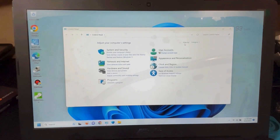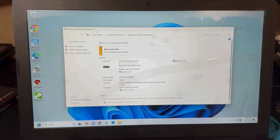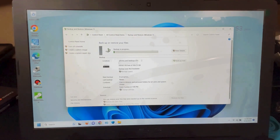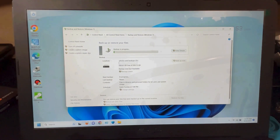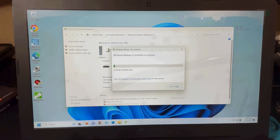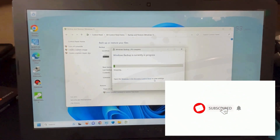In Control Panel, go to the category view and click Large icons, then click on Backup and Restore. By default, it will see your old hard drive that you just formatted, and you can back up to and restore from that same drive. That's it for this video — thanks for watching. Don't forget to subscribe, give it a thumbs up if it helped, leave a comment and I'll get back to you. See you in the next one!